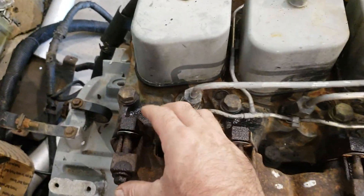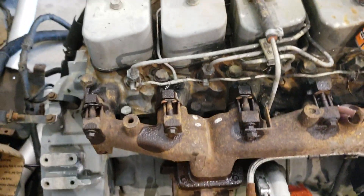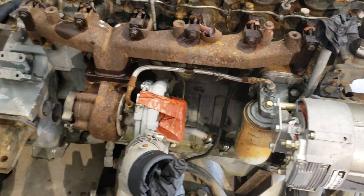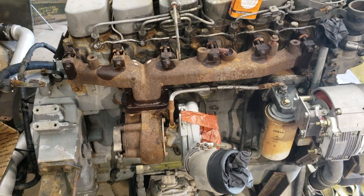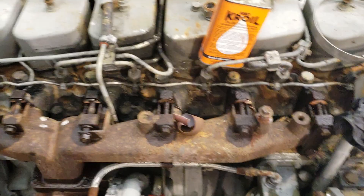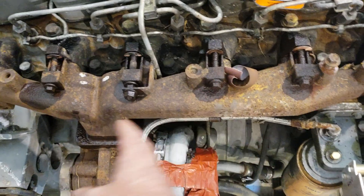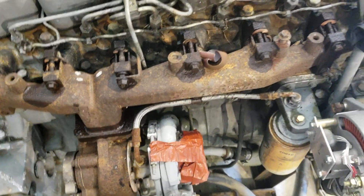It could maybe be repaired if you know somebody who's good with cast iron welding or whatnot, but usually your best option is just to replace it. So I just wanted to show you that as an example of why a lot of the aftermarket manifolds are multi-piece. If you split this manifold into three pieces where they press together, then it's got room to expand and contract without breaking stuff.